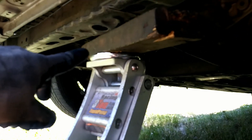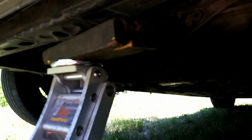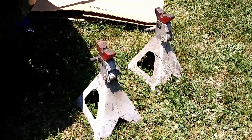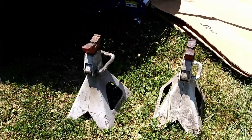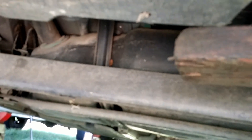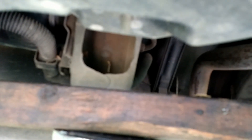The reason I'm using the board here is I need a little extra space because my jacks are bigger than most people's and they're higher even at the lowest setting, so I need the car to be a little bit higher. I'm talking about the safety stands — they're not technically jacks. In the back there's sensitive stuff so you have to be careful where you put the jack. There's a gas tank, batteries, suspension components, but there is a support that sticks way down to give you something to put your jack on.